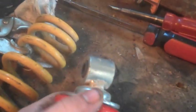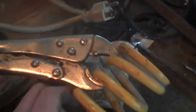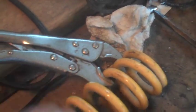There's a little rubber grommet. You're going to take a screwdriver and slide that down to the bottom of the shock stem in there. Once you've done that, on the opposite side of your keyway, you're going to put some vice grips on your old shock like this. To compress it down — it doesn't take a ton, but just enough to where you can get the collar to slide out.